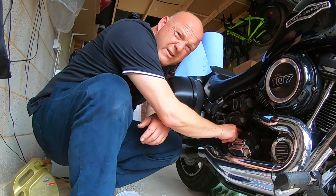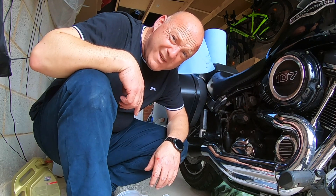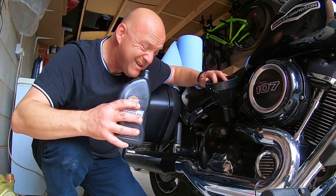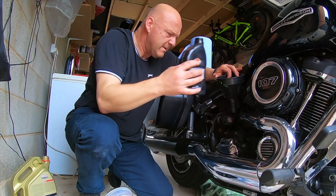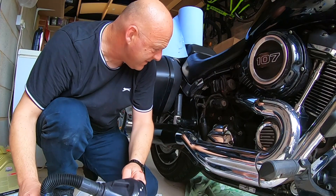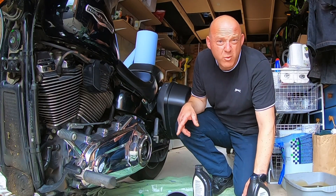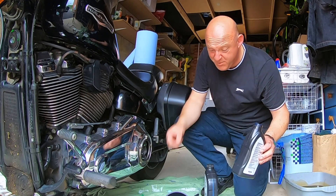And also the transmission oil — done. Transmission dipstick out. Now putting in 0.83 litres of transmission fluid using the bendy funnel — very handy, and it's got all the figures on the side as well. Done. Button it up and check the levels — that's for another video. Primary fluid going in next: 1.18 litres, basically a full litre plus the residual from the transmission container. Through the bendy funnel again — that's it.